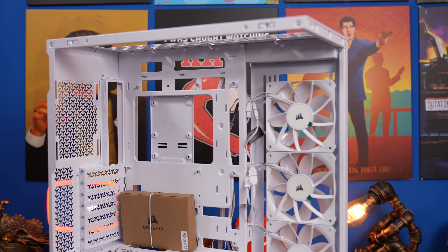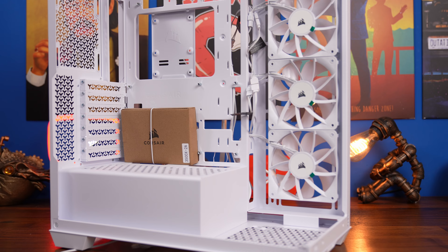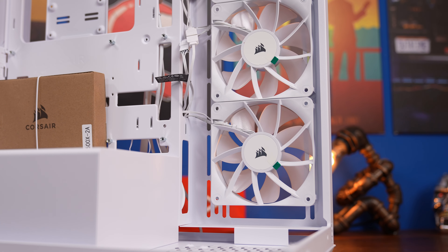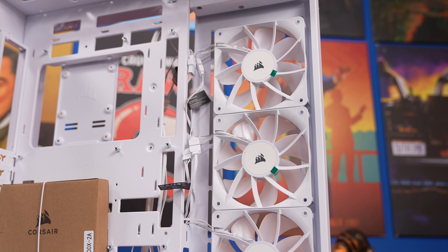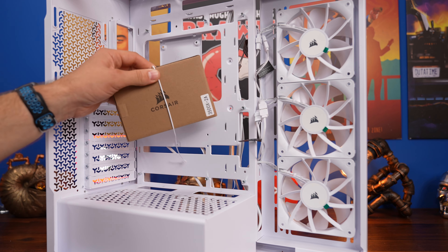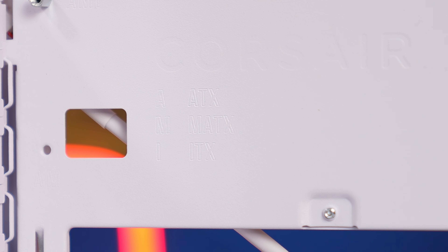At the rear the setup here — there isn't a great deal of space, and I want to mention that so I'm going to show you the cable management for it later on, especially if using a rear connect motherboard, as it becomes very important. There are a lot of cables to deal with from the fans and from the top panel buttons. These are the RS120 ARGB fans, which I'm going to keep in place; they're set to intake as standard.